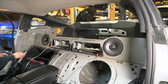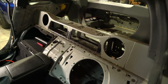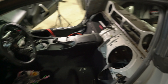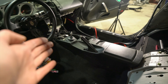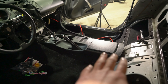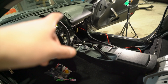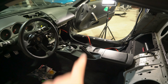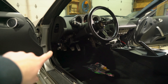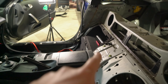After taking out damn near half the interior, I think we are finally ready — we're at a point where we could put speakers in. The next thing I'm going to do is get all of our wiring laid. Usually when I put a car stereo in I'll run some wires down the center console and back, but that's not going to work in the Z because of how everything meets up there — there's no room for wires. I've got a little bit of a head start on the power wire to the battery compartment up here. I'm going to run the speaker wires and RCA cables back under the dash over here, then down the side, up through, and into where the amp is over there.